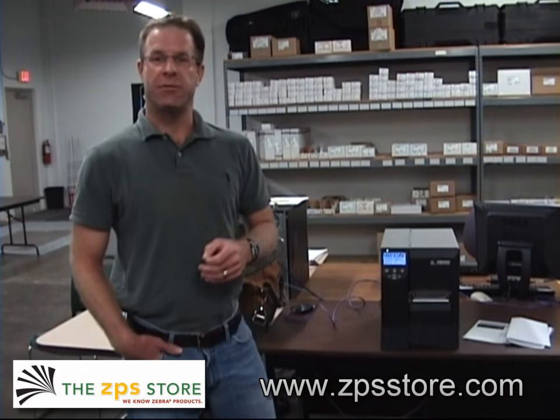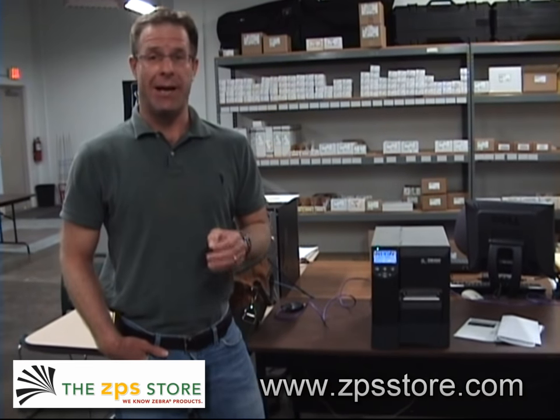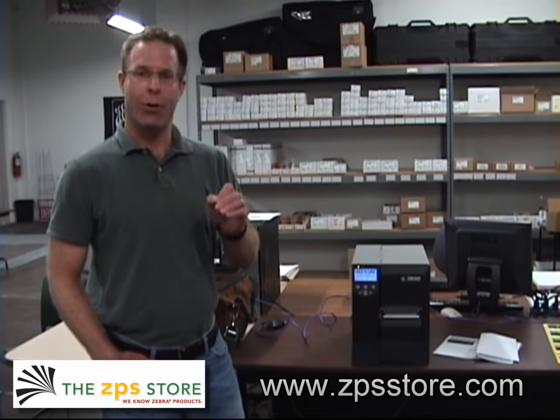A lot of people will just react when printing goes south. You go out there and think it's a print head and that's going to solve all your problems. It's not always the case. It can, honestly, be an unnecessary expense. So really, this test is going to boil it all down, tell you whether it is or isn't the print head. And again, we call it the pause test. Real easy, anybody can do it.